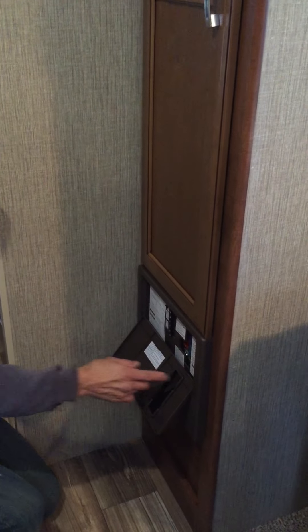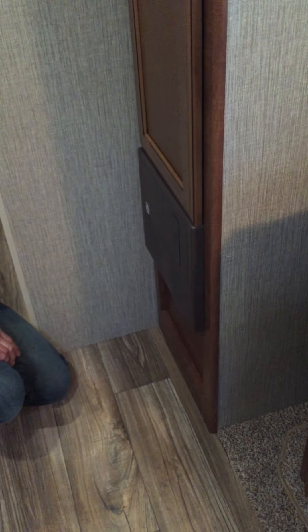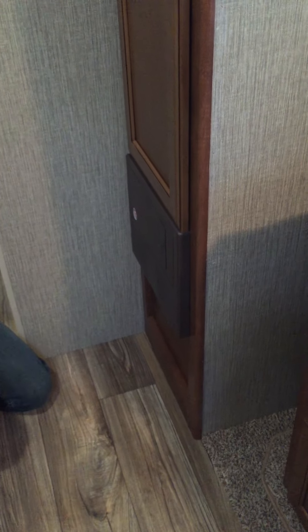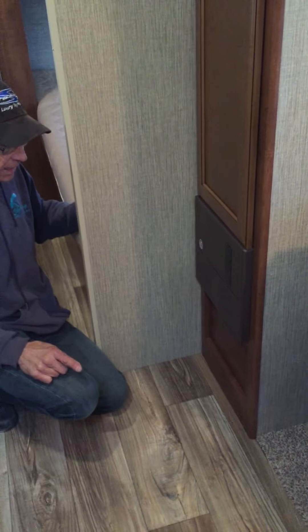Whatever you're running — if you turn a light on and it doesn't work, leave the light on. It'll tell you if the fuse is out. I've had four people come back under warranty: they turn something on, it doesn't work, they turn it off, then look and tell me the light doesn't work. When you turn the light switch off, you've broken the circuit feedback to here. So leave it on and look to see what's not working — leave it on.